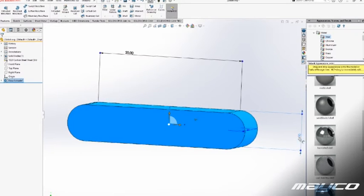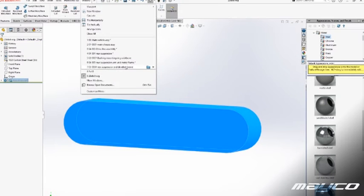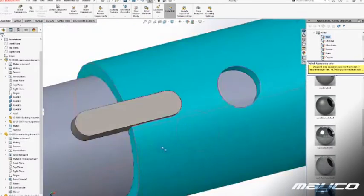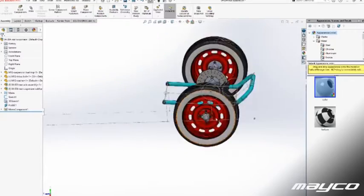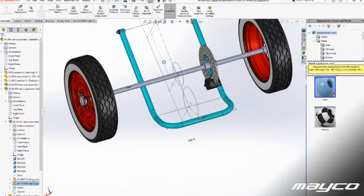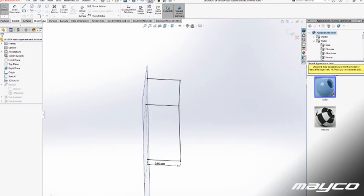And of course, as you might have seen, the transition from the side to those rear strut mounts is quite a complex shape, but it's a shape that really focuses the energy well and spreads the energy over the side of the vehicle if the vehicle is hit from the back. So I think that the plate at the back should not be so complex, can be just a simple straight piece with some holes in it, a little bit thicker material as I mentioned. So that is also something I'm going to change, or I already have changed.